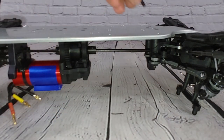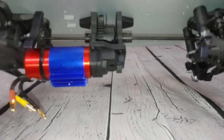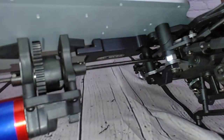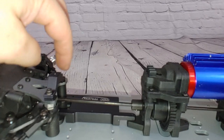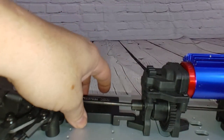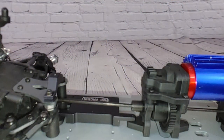Let's put this longer screw in and get this going. I'm going to drop it in and turn this up a little bit. All right, that was done — I love it, I like it a lot. I can feel it sandwiching that plastic piece down there too, so it's got a really good hold on the front of that piece as well. This should actually help keep the front dog bone in a straight position — it's not a top brace, but it's going to take pressure off the top brace because it is bracing the bottom piece.